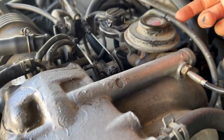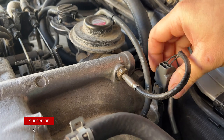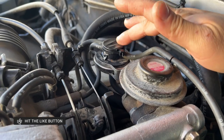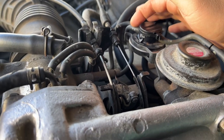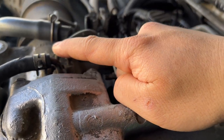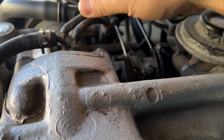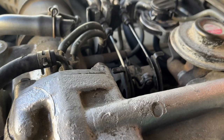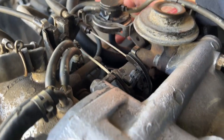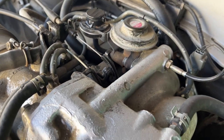So this is it right here — we have one vacuum line that goes right down here. This is the EGR temp sensor; you can just unplug that. You've got this vacuum that goes to the modulator, and this vacuum here goes down to this one, and then this one out here goes to this one. Once we remove this, we're going to cap this right here — these two you can cap or just route one back to the other in a U-turn.